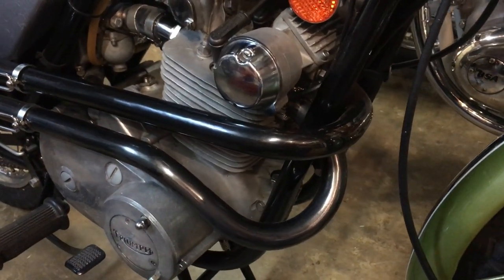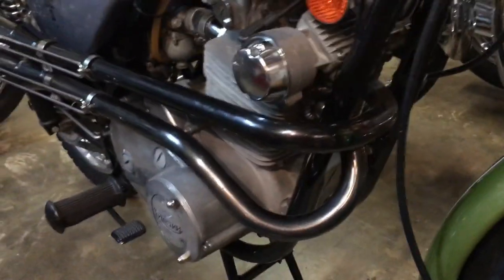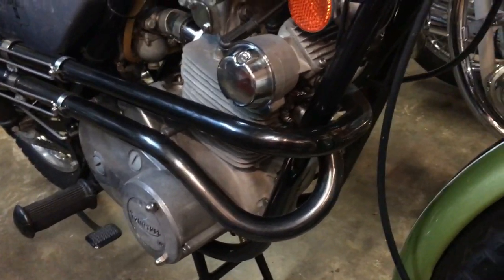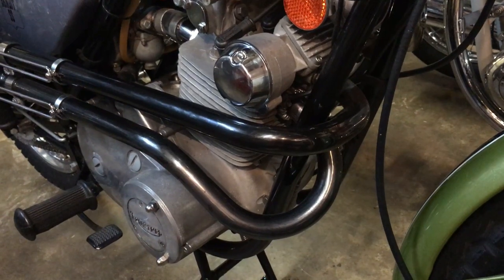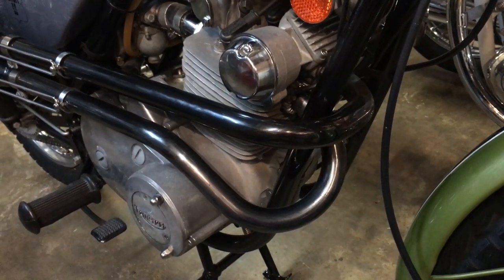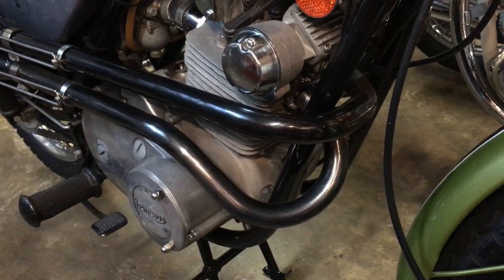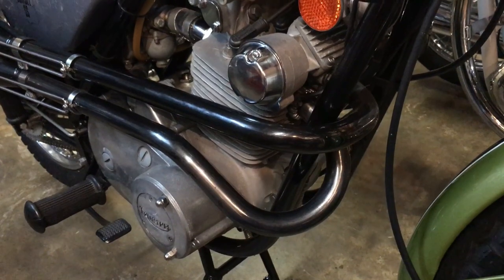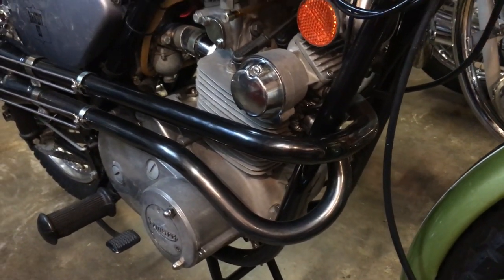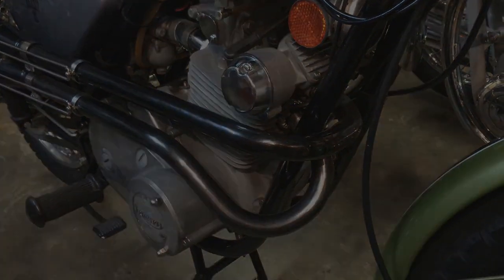So next thing, plugs out. Spark plugs, that is. Timing plug out the front. And then we'll sort out some sort of contraption to act as a plunger on the crank, and then we'll get the crank in the right position and see which cylinder we need to be messing with, and then we need to check the wiring back to the coils. So anyway, initially let's get the crank in the right position.